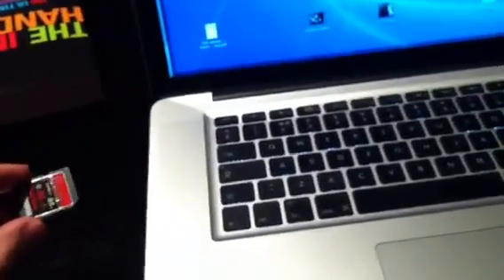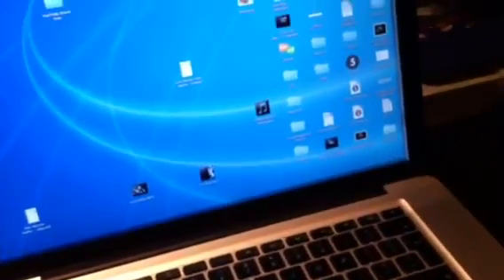What I've discovered is, if you put the card all the way in — which is what you kind of want to do — the edge of the computer lines up, it kind of goes through the middle of the dot on the 'i' in the Apple logo. So if you're having this problem, take the card out, give your Mac time to adjust to it not having a card in it, and when you put the card in, put it in but not all the way — so that the space is above the dot of the 'i'. I just didn't put it in as far as before, and count to about 20 to give it time to mount.